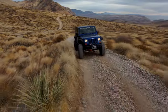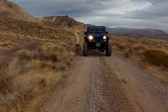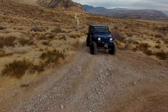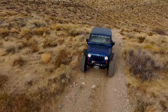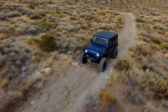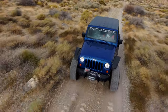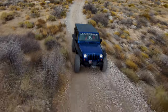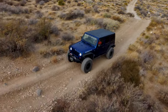So what I did was we took the range sensor from the Chrysler and we actually mounted it onto the four-wheel drive shifter down here. And it worked great. We made a little cam setup, so as you move the shifter, the cam would push the plunger in and out. It still works great, but it happens to be unplugged right now during the upgrades, and that's why that sway bar light is flashing, because it's not the sway bar module, it's also acting as a fault indicator for the transfer case range sensor. So we'll fix that. Our tire pressure monitor's on, and it's not because the tires are too low, it's because they're too high. I checked them a little while ago, and they were about 38, 39 PSI.